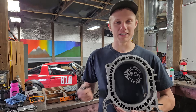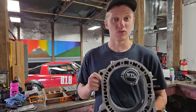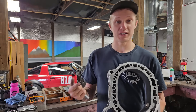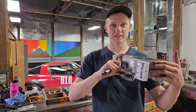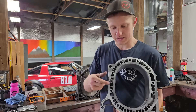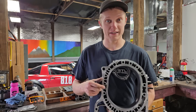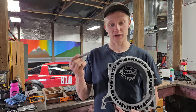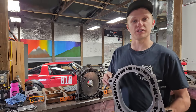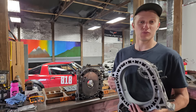The local machine shop had never actually seen a rotary engine before, but to any competent machinist, making a hole a certain size that lines up with other holes is a very simple task regardless of what it's in — especially this one being in aluminum. One of the issues we did run into is that aluminum has a tendency to smear chips onto what you're machining, especially with a hole as deep as this housing. So we actually used a really small hone and went in there and polished up these holes so that the dowels can slide through very easily but with very minimal play. You don't want too much play such that they're actually functioning and you're not just putting all the stress in whichever dowel has the tightest tolerance.